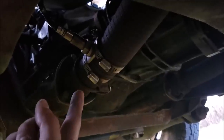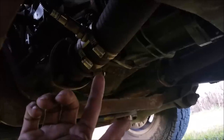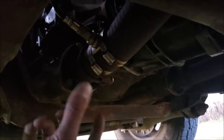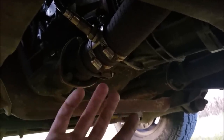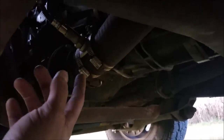Getting down here looking at our O2 sensor plumbed in. The first thing you'll notice is we're only plumbed into one cylinder bank, and they do make setups that tap into both. But really, one is pretty much just fine. If you want to be really exact, you can go ahead and plumb up two, or there are setups that can pull off of both sides. This is okay for this truck — we just need to get it dialed in.